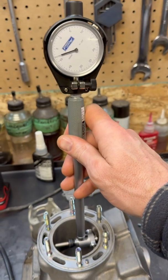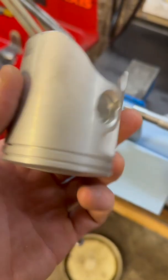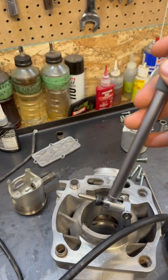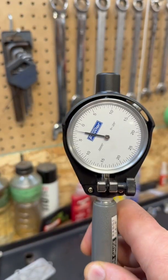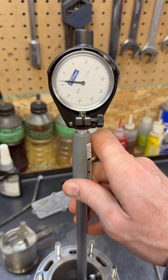I'm going to check the other way too — top and bottom all over the place. I've got four and a half there. Now I've got my brand new piston here. I've set the micrometer to this new piston and zeroed my dial bore gauge to that new number. I can see the difference was about two and a half thou — just over two thou on top, just over two and a half here.